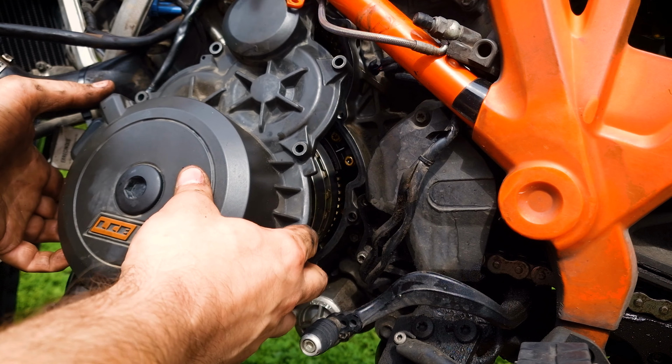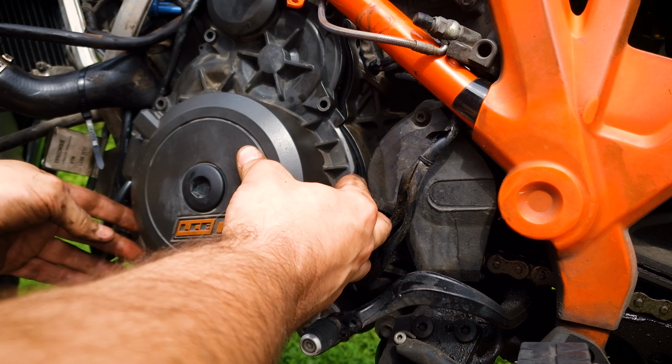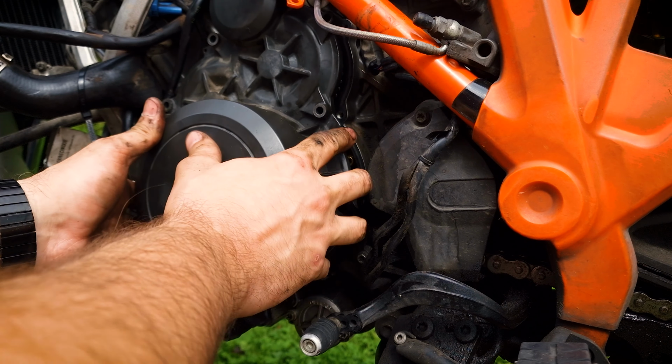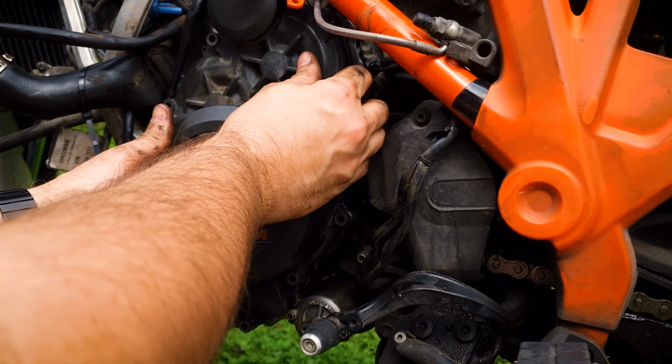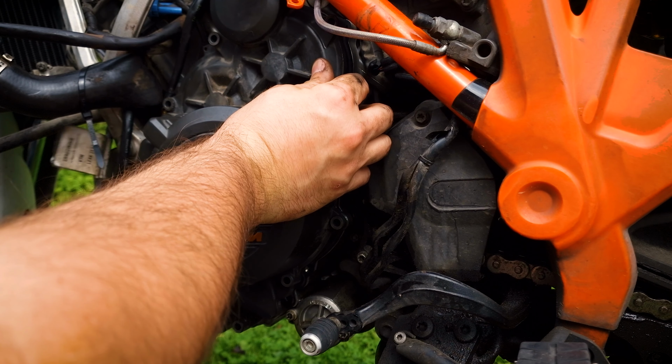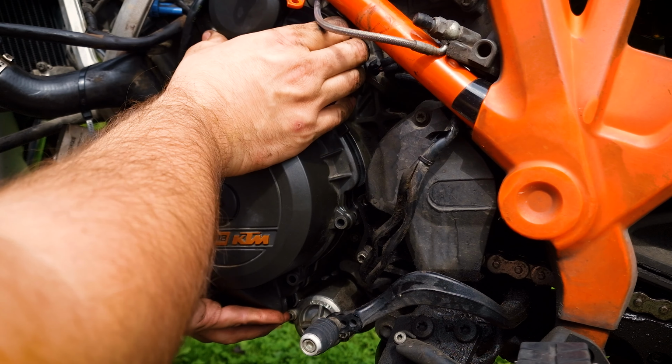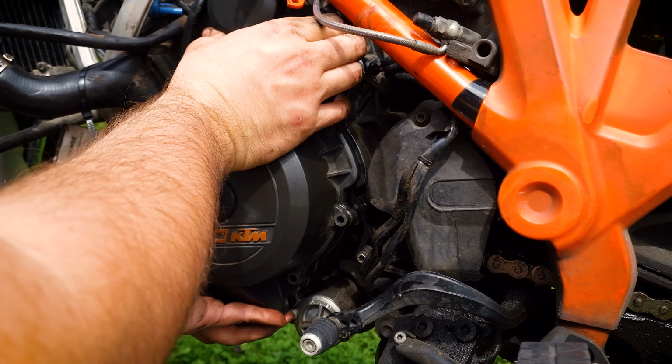Putting the cap on is the same thing. The cover tries to magnetize itself to the rotor and it twists. It is absolutely impossible to put it on. To make it easier, put all the gears on the motor side, do not leave them on the cover side. The cover itself you must put on completely straight.